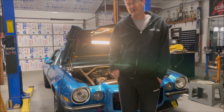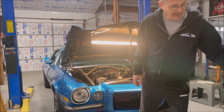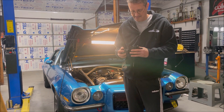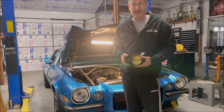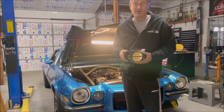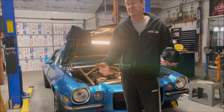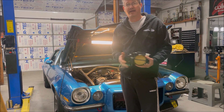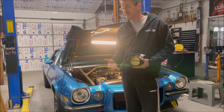In our next video we're going to show you the bracket we'll have available if you're interested in using this intake manifold with a cable-driven throttle body. We're also going to do a throttle body test — testing a 92mm versus a 102mm. We've got some cheap Chinese Amazon throttle bodies and a 102mm on there now — that's a huge difference in airflow. I've always been curious what that'll do. I'm also curious whether the bigger throttle body might have been causing the power loss down low.